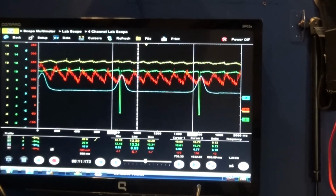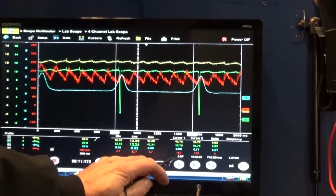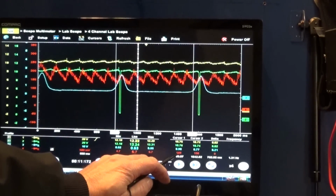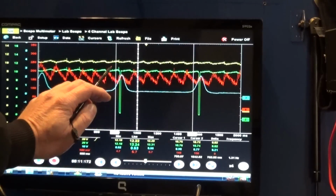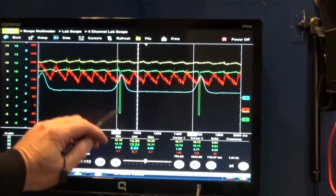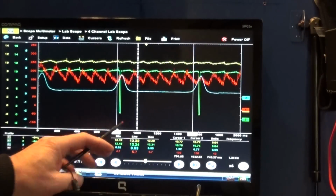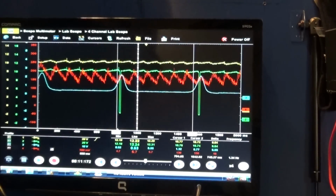and amperage goes down, because now we are no longer on top dead center compression, we can see that our current at this point is 140 amps, and our voltage went back up to 10.75, so the battery recovered. Now at this point, when the current is lowest, it's 130 amps, and the battery went up to 10.7. That's why it's important to have a good healthy battery and a good starter to do this test.